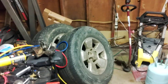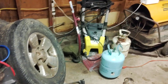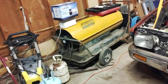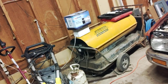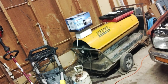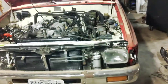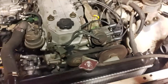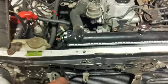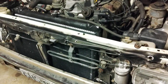After you do that, vacuum the system for a bare minimum of 30 minutes — that's my recommendation. You can throw the vacuum pump on there and let it run for an hour or two to get any possible moisture out. I also highly recommend replacing absolutely everything if you want it to work reliably. Also, no fan shroud right now — that's a big no-no for performance. From the factory there's foam tucked in around the condenser to help suck more air through it; I'll eventually put that in.